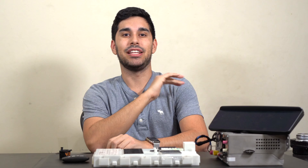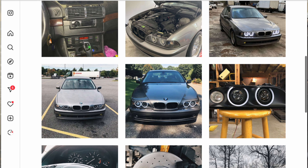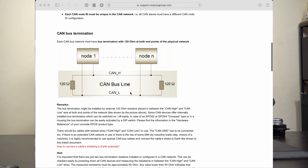If you think I felt internal pain up to this point, this was only the beginning of the great suffering. I was just throwing things at the wall to see what stuck. When all hope was lost, I met Hakim — and Hakim is a genius. He pointed out an environmental requirement of K-CAN: it's a two-wire system where the rapid alternating current creates messages, and one wire is basically the inverse of the other. In short, these two wires need to terminate with a 120-ohm resistor — two of them. So I bought a 120-ohm resistor, spliced it in, added it to my circuit, and experienced — nothing again.